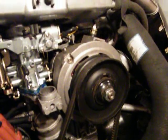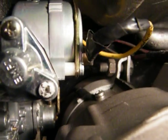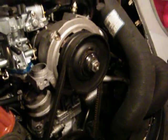Right here you'll see a brand new alternator — I put in a brand new pulley. If you take a look right back here, you're going to see your main battery post. A little further back, there is a green wire which will go to that post, which leads underneath your back seat. You'll have a red wire and also your main power wire there. There's also a ground wire — a brown wire — attached to the alternator itself.